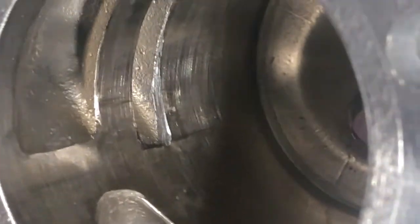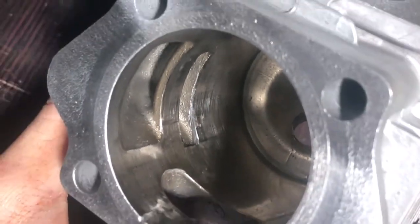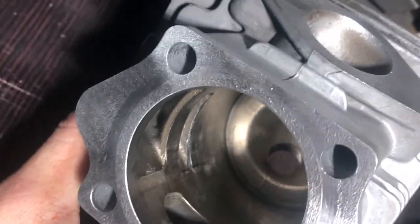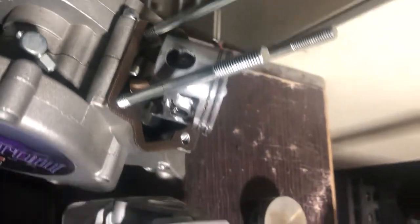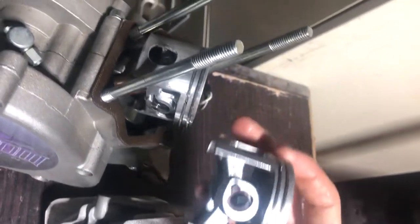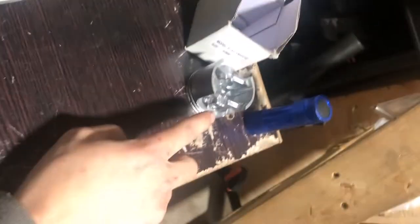You can see that grayish line - that's where the piston ring end gap is. Basically the main issue that has been causing everybody's ring catching problems, which I'm sure they know - the locating pins for the end gaps on these pistons, whether it be the Phantom 85 original piston or the MS380, have the same issues. The MS440 also has this problem, which I'll get to in a moment.